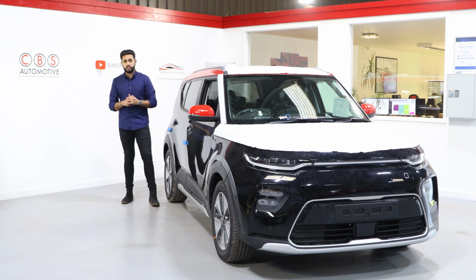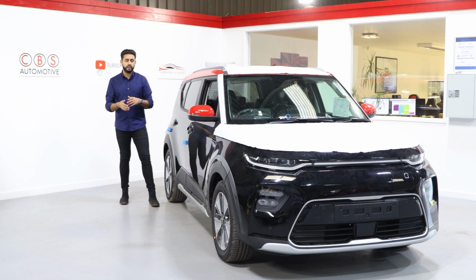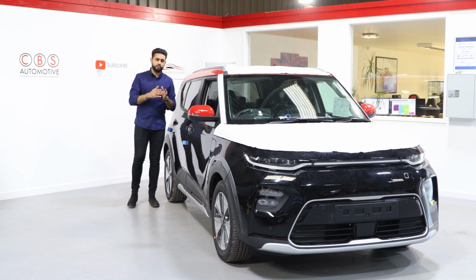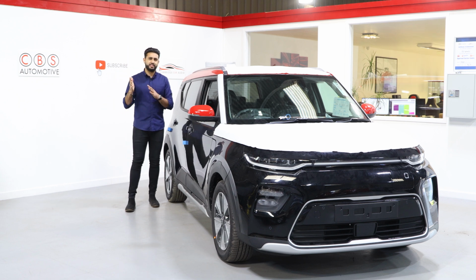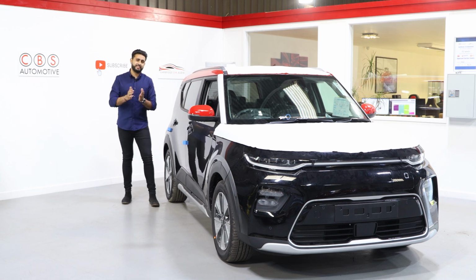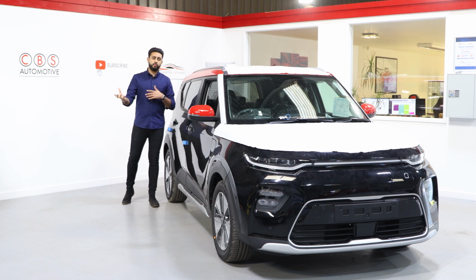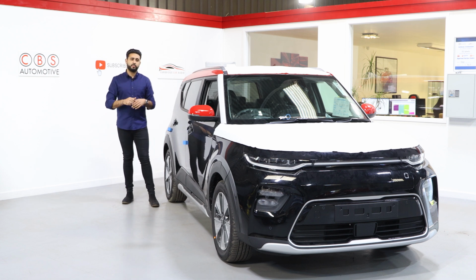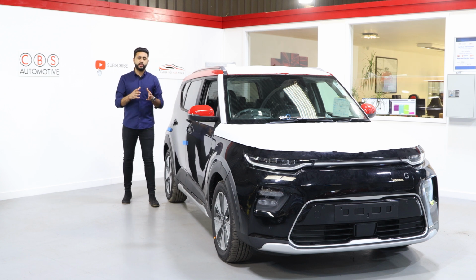So they look absolutely stunning cosmetically from the outside of the vehicle because they're 17mm, they're very, very small, plus they're always color coded to the vehicle, as well as the fact that on these solutions the automatic solution will basically turn off after around 16, 17 miles per hour, and then automatically turn on below around 6 miles an hour. We customize that depending on the vehicle, and basically what we're doing in terms of that is grabbing what's called a speed pulse from the vehicle, providing the kit with that, and then we're carrying out the installation to the highest possible standards.